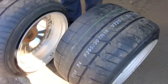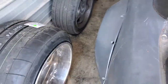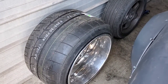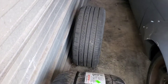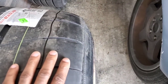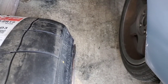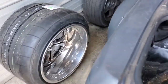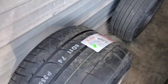Just got off the phone but I feel like showing this — the difference between the old rear tires and the new rear tires is about a tire's width. If anybody wants to know what a 355 looks like on a 15.5-inch wheel, that's how much stretch you'll have. I was not able to get these balanced — they were too wide for the balancing machine. I'm going to see if I can contact some performance shops to get those balanced.